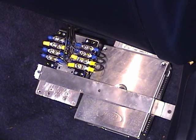Now understand, when we probe that wire back there at the inertia switch, when you cycle the switch, the light comes on and then it turns off. The reason it turns off is it's waiting for a pip signal. If it doesn't receive the pip signal, in other words the engine turning over, it just simply shuts the fuel pump relay off.